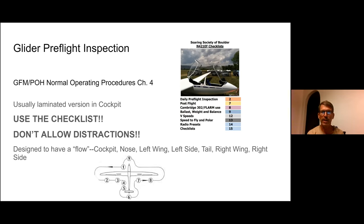So preventative maintenance, what does that mean? Basic non-structural repairs, lubrication, hydraulic servicing, tire replacement, upholstery. It can also mean a chip on a surface or something like that, but it's a real good idea to consult an expert in fiberglass surface repair before doing any of that type of work, or maybe just have them do it. And here's the laundry list of things that are actually included under that Part 43 if you want to look through it sometime.